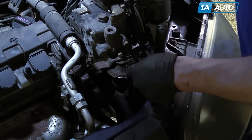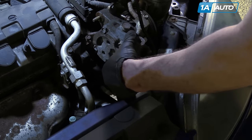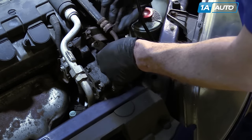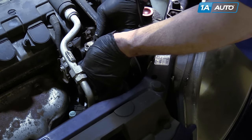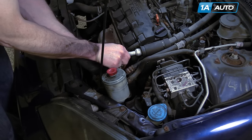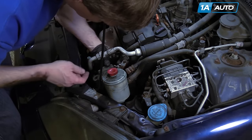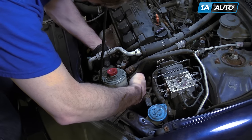Bring the pump down — this stud goes right up through here. Push that through and get it up. The large washer nut goes on the backside of that. Put this bracket up in place and the 10 millimeter bolt down and in. Push the stud through — you can see it coming out right there — and put the 12 millimeter bolt back in place.